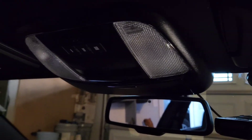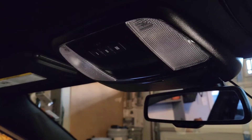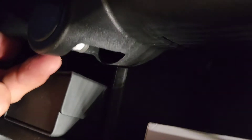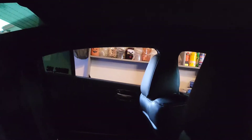That light is still not on — I haven't been able to get it on right. It's been about 25 minutes and I'm frustrated, so I'm going to pass on that and start working on the glove box. This is the glove box light — you have to put tape around it, pull it out, and put the new one back in. It's difficult because you cannot see in there. The glove box light does not come on — it worked with the OEM one and the red one worked briefly, but then stopped. There might be something wrong with a harness in there.